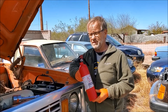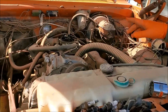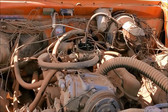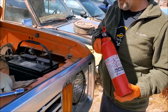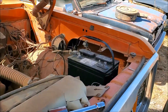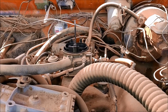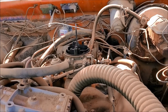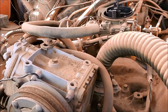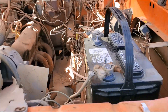We're about to put a lot of current through this thing. As you can see, the wiring harness is completely eaten away, just leaving the bare wires, so who knows what's going to happen. Safety first — we've got a fire extinguisher here. I also disconnected the coil because we've got no spark plugs in there, no wires — I didn't want to back-load the coil. So the coil is disconnected. I cleared off the fuel filter glass so we can see if there's anything pumping up through there.